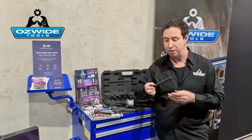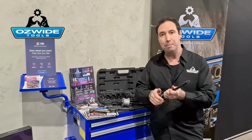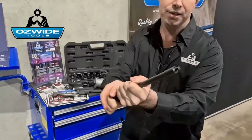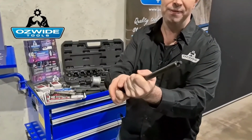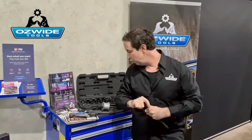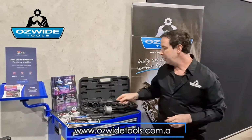which I'm going to show you now. It's just a long shaft, and at the bottom of it, it's like a spigot bearing. So you just turn that out, and it basically spreads those feet, and then you pull out the copper washer, and job is done. So there's a few tips for you regarding tooling.